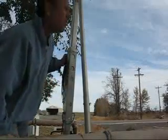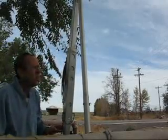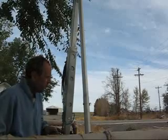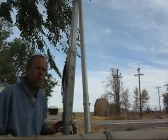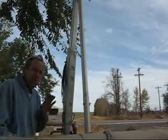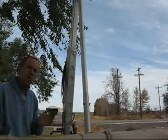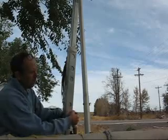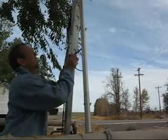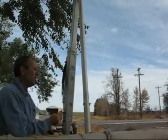Here's another part of my system you have to put in place if you're going to tow a rigid wing versus a flex wing — you have to accommodate the two different tow heights for the nose release. A rigid wing sits really low on the truck, so you want it so that when hooked up through your nose release, your line is just below horizon, slightly downhill to the release point. I've got a pin system: pull the pin, raise the tower up for flex, or bring it back down for rigid wing — two different settings for two different kinds of gliders.